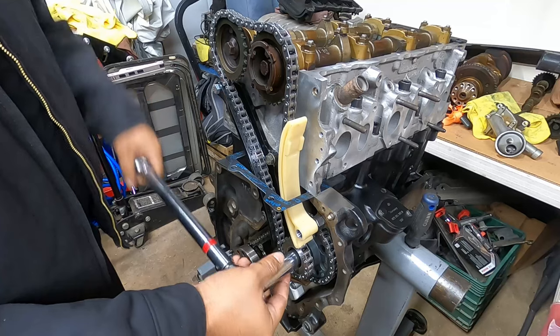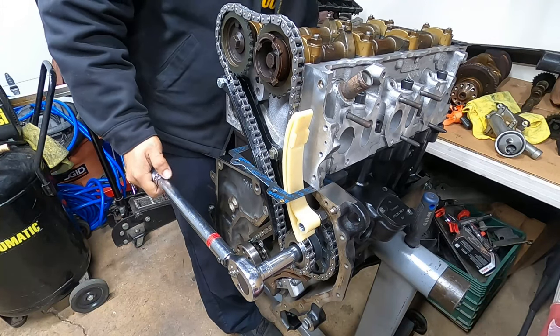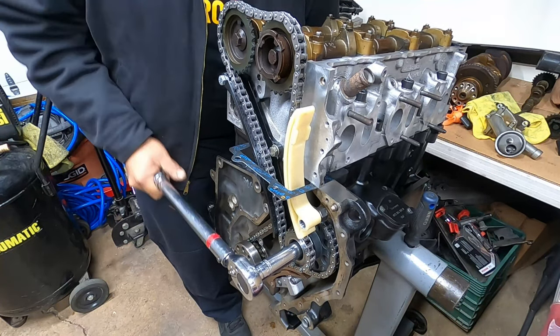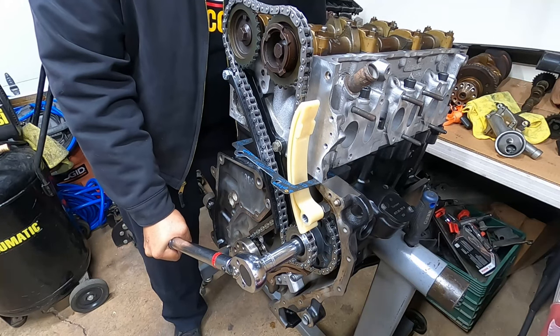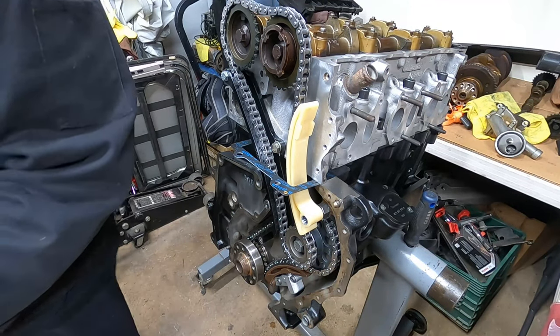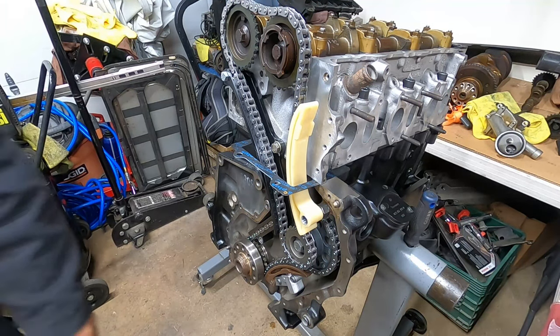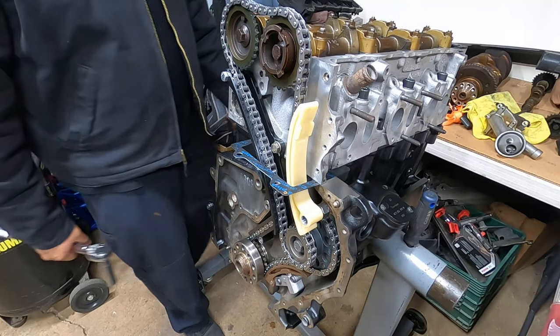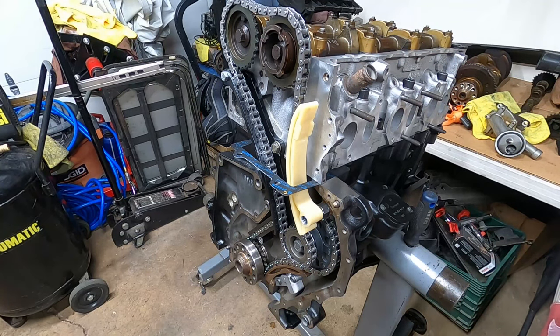So right now, I'm going to get this ready. And I'm holding it from the crank on the front. And there we go, 74 foot-pounds. Before you install the bolt, make sure you oil this bolt lightly. Pop it in, you're good to go. So that's 74 foot-pounds, and then I had to counter-lock it with the crank over here. It was a front crank pulley. That uses a 15 millimeter socket, by the way, guys.